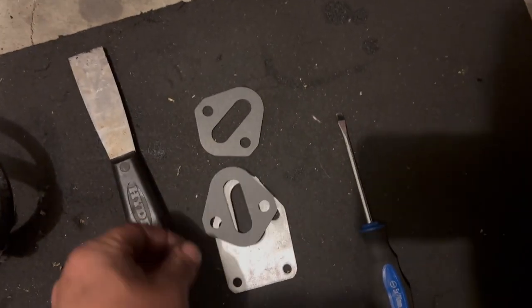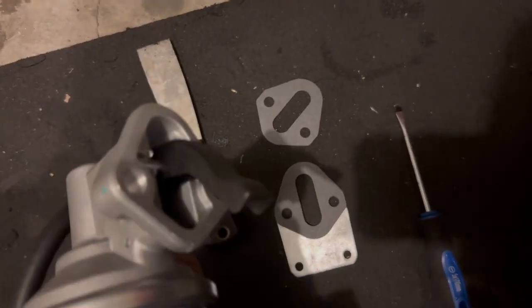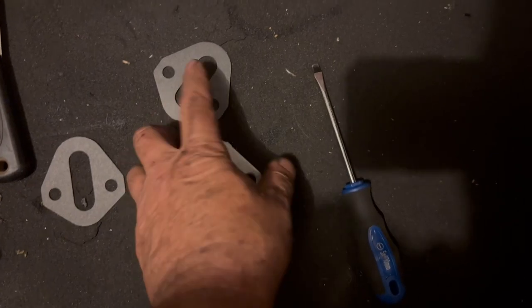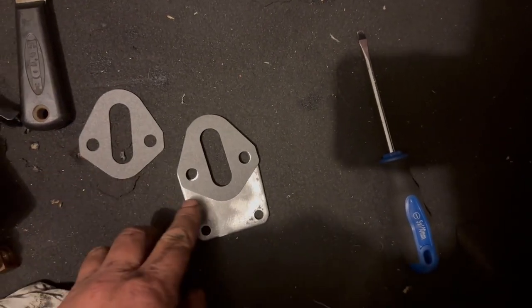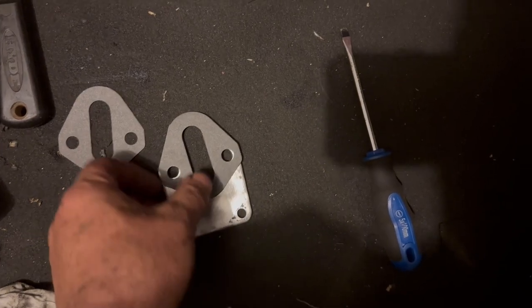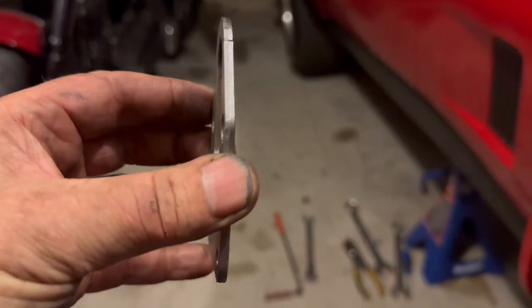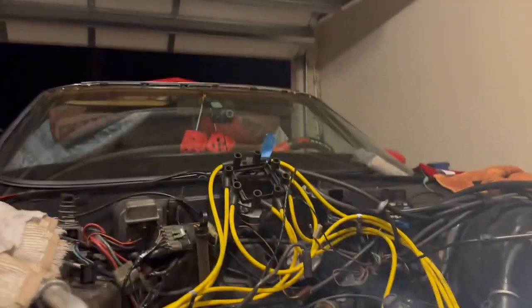What they gave me in the kit was a gasket that fits here, which is fine for sealing the pump to this plate. I'll put that on the outside of the plate. But this gasket is not going to do me any good on the back side because I need a gasket that goes all the way down and around these holes and back up again. If I put it on and then put the plate on the block, it's going to be either cocked or there's just going to be a gap at the bottom. That gasket is just not going to work for the block.